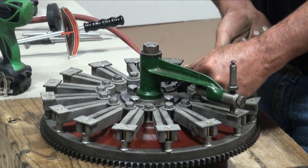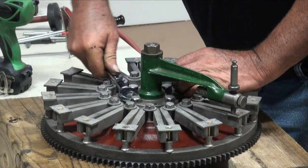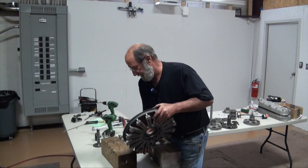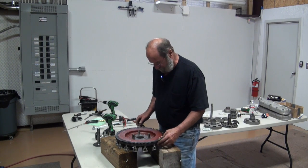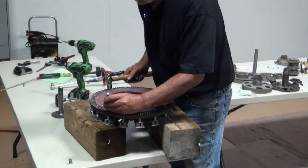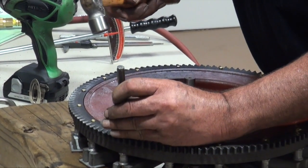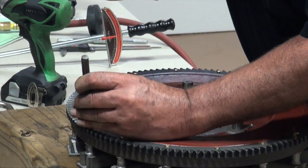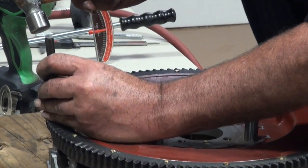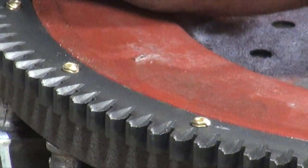I'm going to take our tool off, turn this thing upside down, and punch the brass screws so they do not back out. Put the flywheel over, just set it down on our blocks of wood. Our brass screws that we ran through the ring gear set a little proud, and that's fine. I take a punch and come in here and catch it into the threaded area, giving it a couple of prick marks on each side just to keep that brass screw from backing out. I'll set all of these down and we'll basically be done with building the flywheel magnets and starter ring gear.